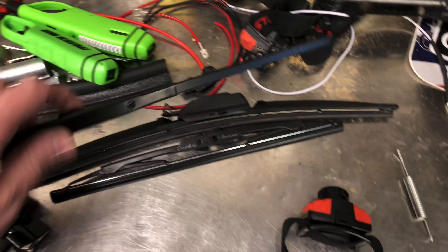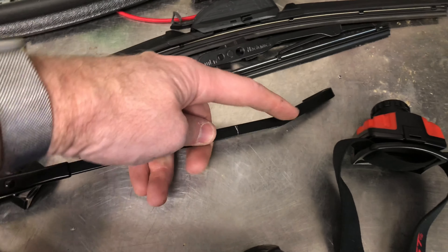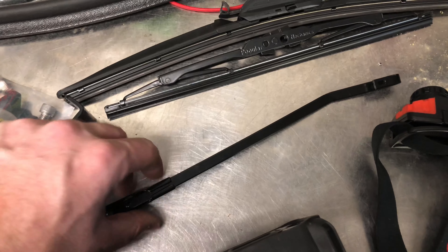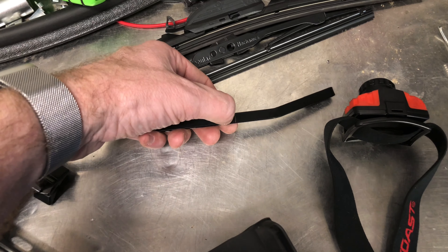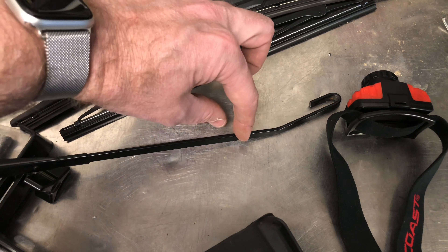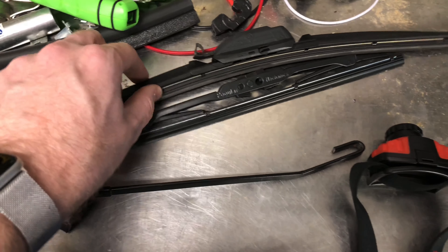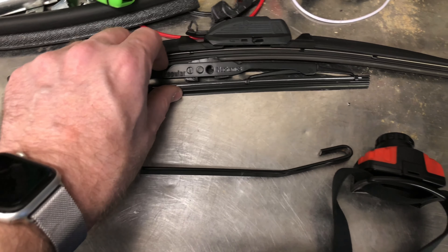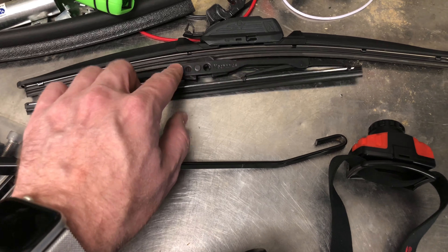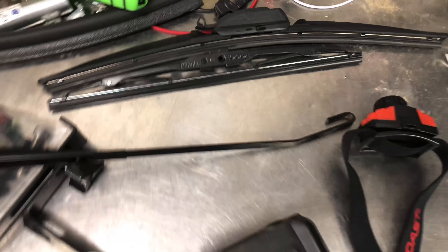I am going to be taking my windshield wiper — I've got that here. On this type of windshield, having this hook at the end of the line here is not desirable, so I actually want to get rid of that. I need to shorten this up by about a total of five inches anyway. So what I'm going to do is cut this off right here on my score line, and then this is going to be the new end. I'm going to basically wrap this around. I think this one is a 16 inch, and then this is a 12 inch. The 12 inch I think is the better fit, but I'll try both of them and see what happens.